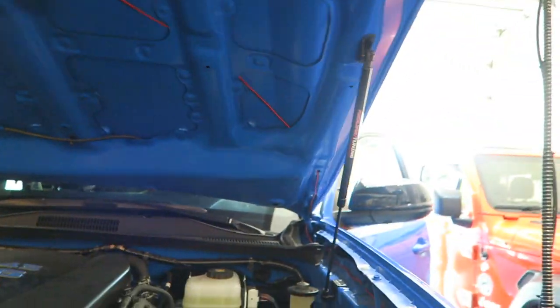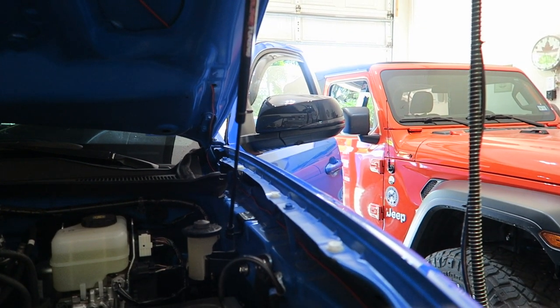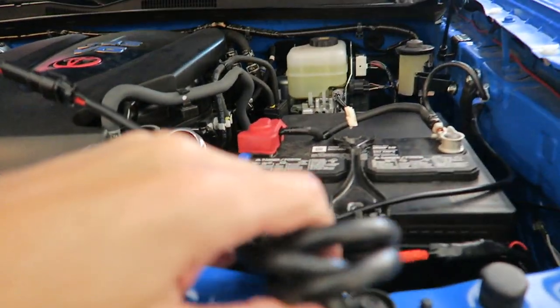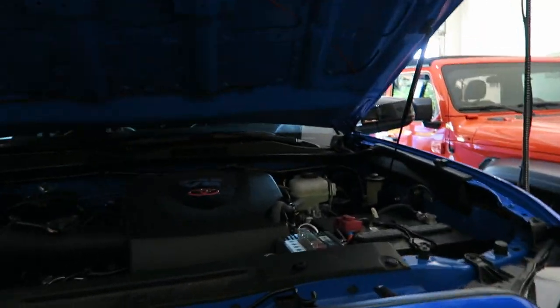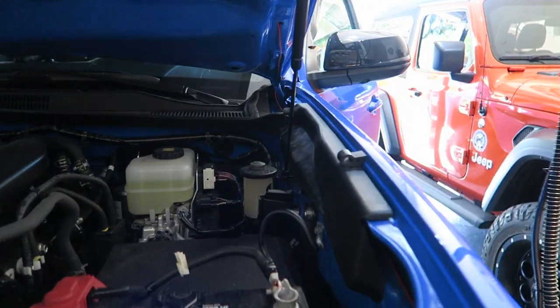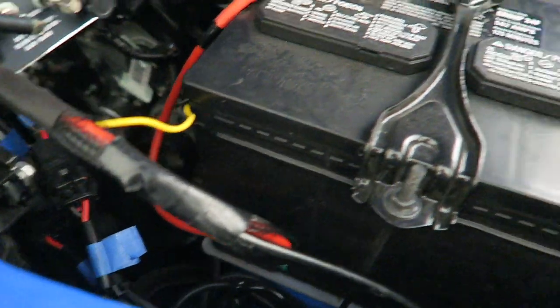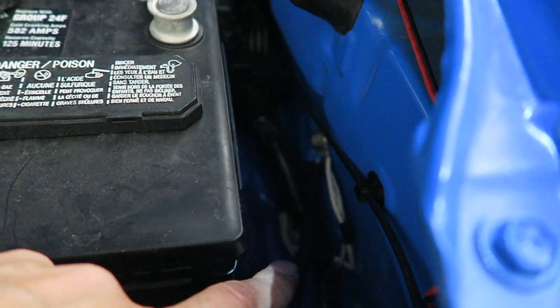Now all I have to do is slip this little cover back on — that's pretty easy. I brought this wire underneath, which is also pretty easy. Then I'll zip-tie this bundle of wire to what's down below there and we'll be finished. Final check — got everything put back together. The side rail cover is back on and everything is secured down there. I did move the ground wire for my Trigger 4 Plus — it was back here and went across the battery. I grounded it down there, much better location.